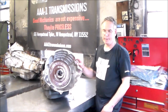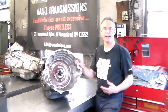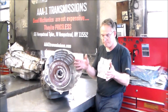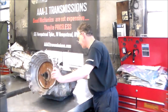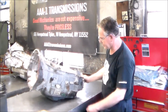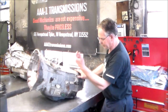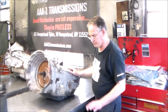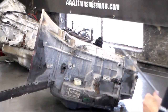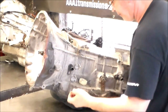I remember I did a big Dodge Ram and after it was done, it started leaking out of the front — here's the front seal — and we had to take it back down again. When I really concentrated on it and looked at the plate, it was out of round, out of shape. I put another one on and it fixed it. Now let's take the two sensors off. If the bolts are a little tight for the input and output sensors, I usually get a small hammer, put it up against the head of the bolt, and give it a couple of taps to shock it loose. If not, you'll have to drill it out. The last one I did, the other bolt was broken — I drilled it out perfectly, put a helicoil in it, and everything worked out good. I only go OE on that line pressure sensor.